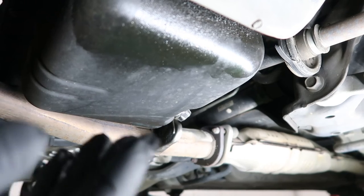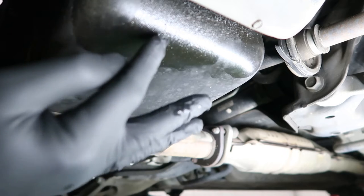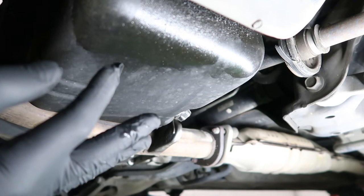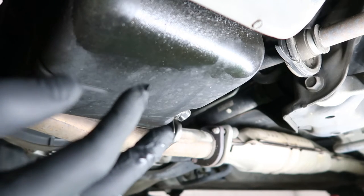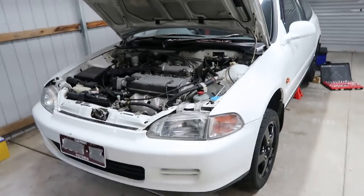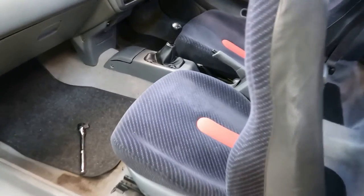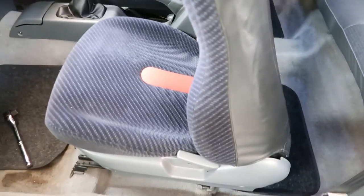While under the car, I found a buildup of oil on the sump. It looks like a slow leak pooling around one of the sump bolts, so I don't think it's going to be a huge concern. I'll just wipe it and keep going. It is now past midday, and I'm yet to drop the gearbox oil and replace the fuel filter, but I really want to get weight reduction done, and it seems like more of a fun thing to do instead.